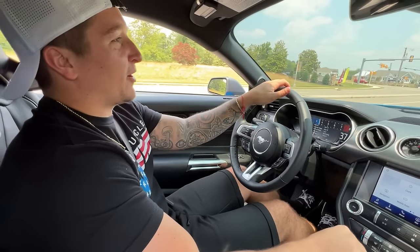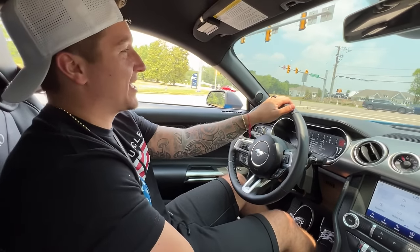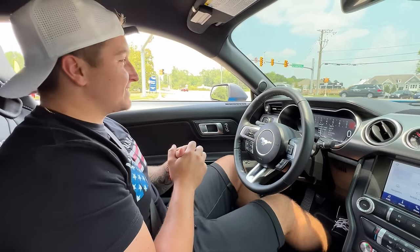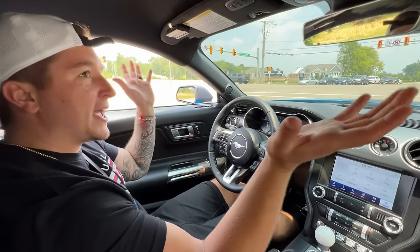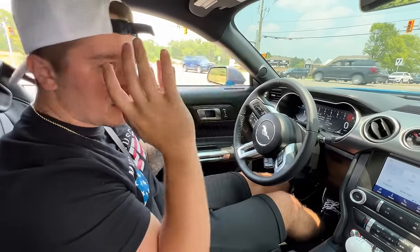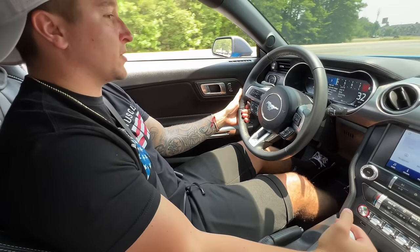Dude, I'm still so impressed with how good it sounds. This sounds really great. Not much of an install, let alone the mod is just so simple, and that's the outcome. If you know what you're doing, 20 minutes. Literally, you just got to go underneath the car, get it jacked up, you put the X pipe up to the briefcase because you will have to cut the briefcase off, you make two cuts, and then it just clamps in. That's it. All right, so we're in second gear.